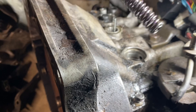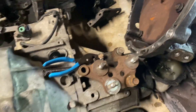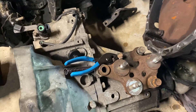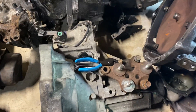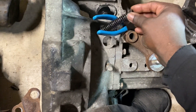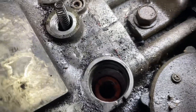After that, you remove the tension springs right here. The tension springs hold tension on the piston — when pressure comes up to the bottom of the piston it just pushes it up, which basically releases a little bit of pressure off your one-to-two shift. It shifts smooth, but we're racing this car, so we want a firmer drag racing shift, not a commuter shift. Every time the pressure comes up it pushes the piston up and the springs force it back down. Your accumulator piston is right there.